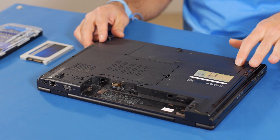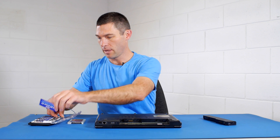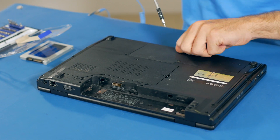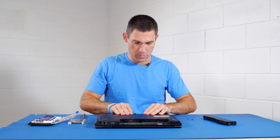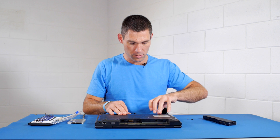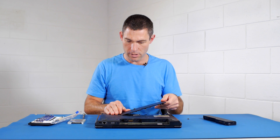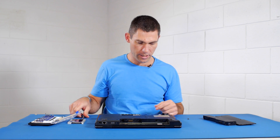To get access to the drive bay on this laptop there are two screws here, so I'm going to get out my PH00 bit for that. This cover just needs to be wriggled a little bit — lift up one end slightly and then wriggle it out from the other end. And this is where our hard drive is.